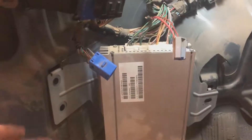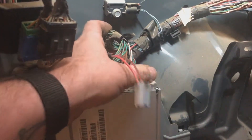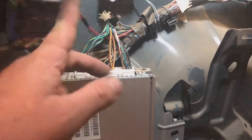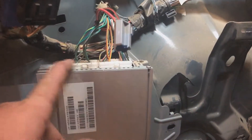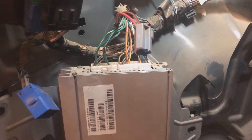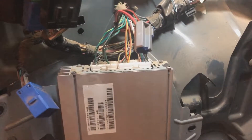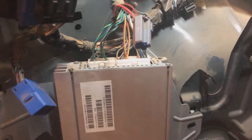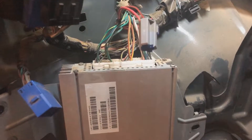While I've got you in here, I'll explain what I think is happening to these amplifiers. That's about where it's situated when actually mounted in place. What I believe is happening is water is getting on this harness and trickling down straight into the amplifier. If we were to open this amplifier up — which I think we might do — I think we would see a lot of corrosion, which is obviously making the amplifier not operate properly. Let's finish pulling this out and see if we can find some corrosion inside.